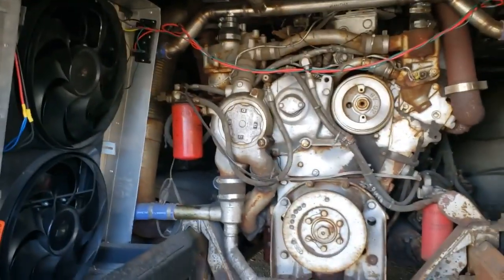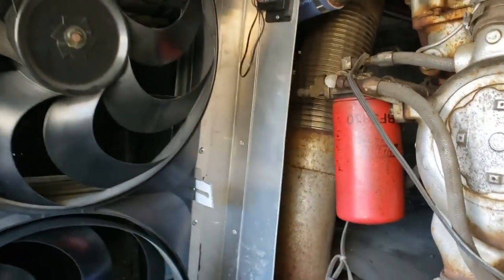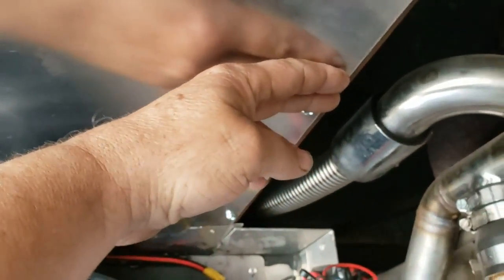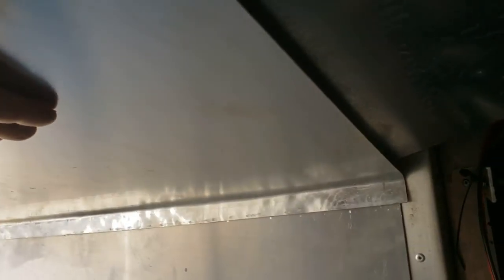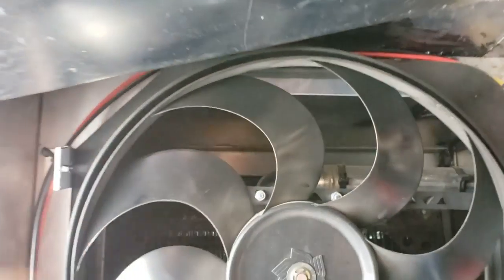Up at the front here — I'll crawl inside. I angled this piece of aluminum from the engine compartment, angled it down to this five-inch level where the furnace ducting is, and that kept it away so it didn't obstruct the fans at all. It's all boxed in on the ends and everything here, so it'll be all sealed up permanently when I spray some foam in there.